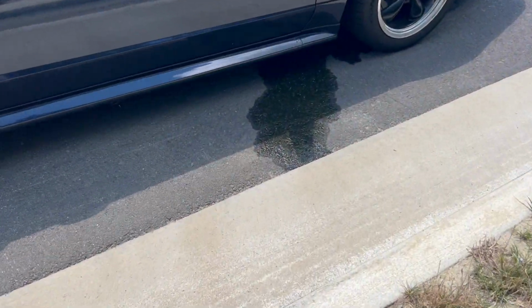Today's video, we are starting the teardown of the 2001 Mustang GT for the intake. The intake cracked a couple of videos ago. Y'all seen where I cracked the back heater hose tube on the intake, because the intake's plastic. All the 4.6 liter Ford motors came with that plastic intake, so I went and got a Dorman intake instead of the Ford Performance one, because there's a big back order on that.